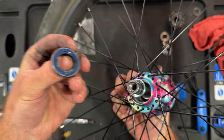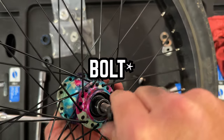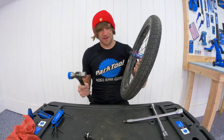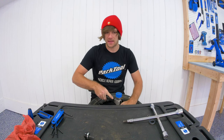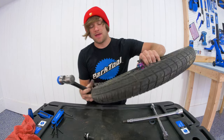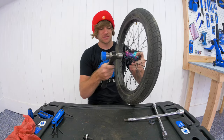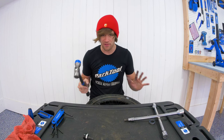We have this side loose — we can slide that bearing off and set it aside. Now we take the axle, tighten the axle nut in, and because the bearing is out on this side we just need to remove this bearing by hammering from this side out through there. The inner bearing on the inside of the drive side can be very difficult to get out, so I'm bracing it properly. One important thing: as you get the bearing further out and you're getting closer to the hub, hit it less and less hard so you don't completely ruin the flange on your hub.